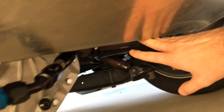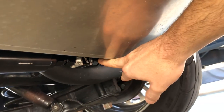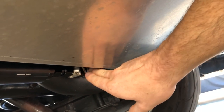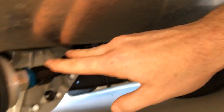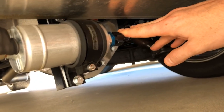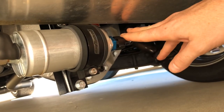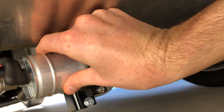It's dash-8 all the way, with an Earl's full-flow ball valve here. You want to make sure that there's nothing that's going to restrict the flow into the inline pump, because that's the main reason inline pumps fail — they don't suck, they push. They do create vacuum, but it puts a lot of strain on the pump. If it has to pull the fuel versus just being purely gravity-fed, it will eventually cause the pump to fail.